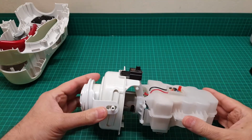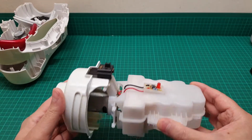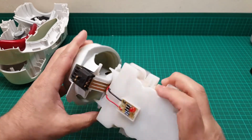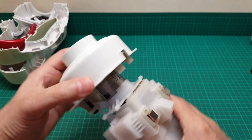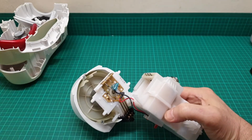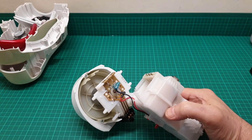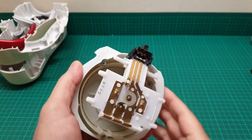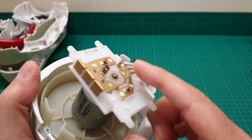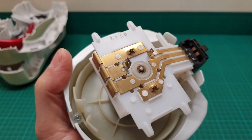And this is the mechanism just to shake the dust out of the filter. So I put everything there, and now I have to take the battery out of here, and it's just push fitted to this part. You just have to separate it from here, and there are two cables there, if you can see. Let me just show you. I just take these two connectors out and I come back. I just took it out from the narrower one for the negative, and the thicker one for the positive. And that's really it. Let me just make it focus.